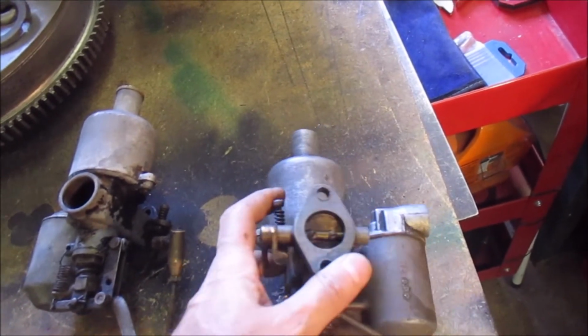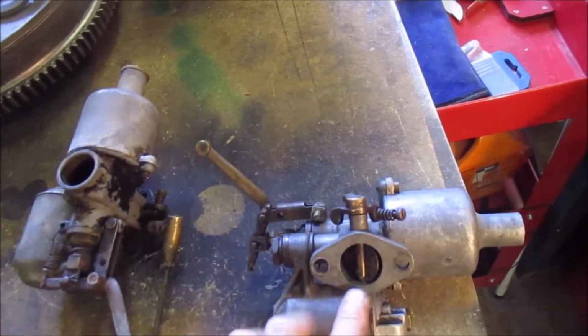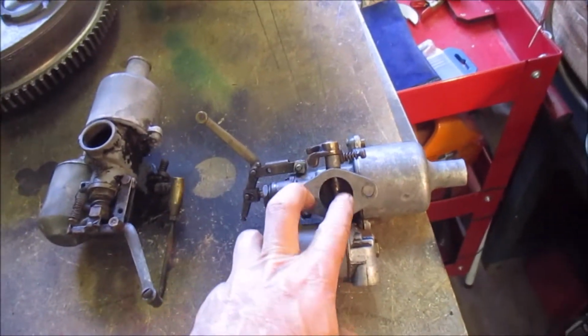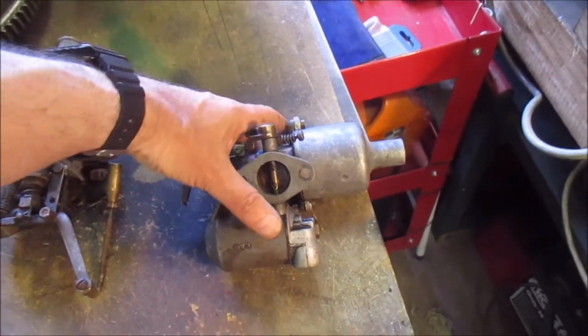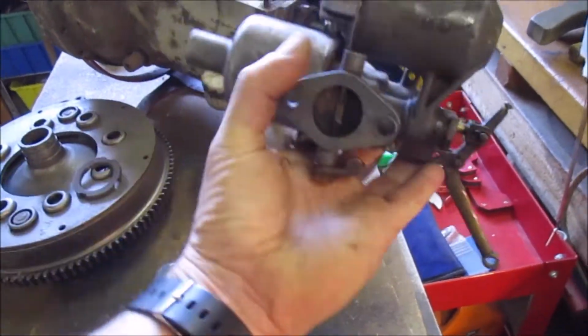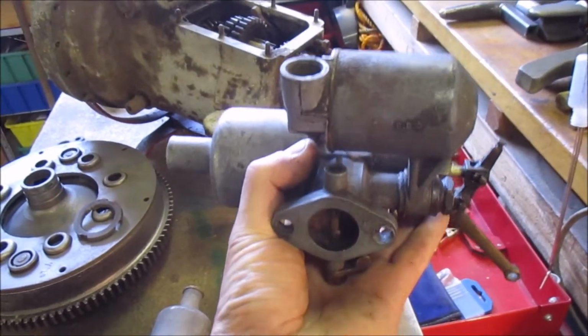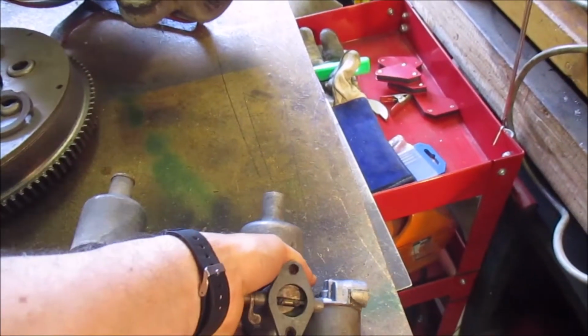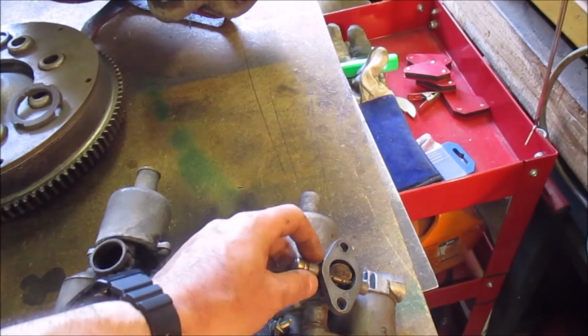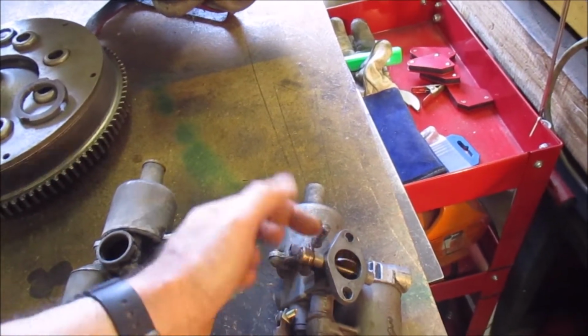And I think if I bolt this to a suitable sort of angle plate or a flat plate that can then go in the milling vise, I should be able to do one side, ream that out, flip it over, then do the other side, and then line ream it. And I think that may work. I do need to figure out what bushes I can get to go in there. I'm still sort of thinking about all this.